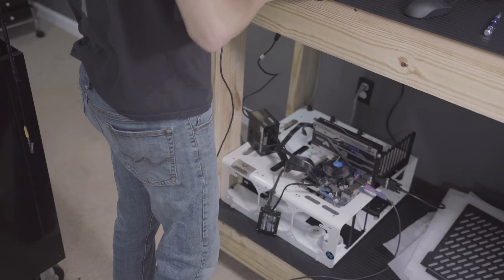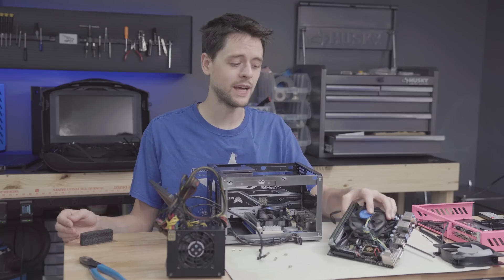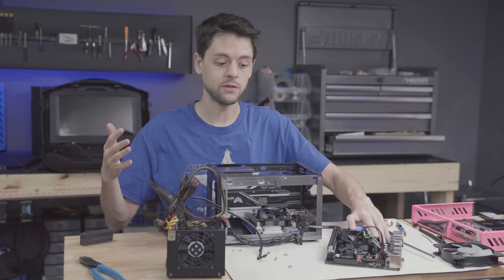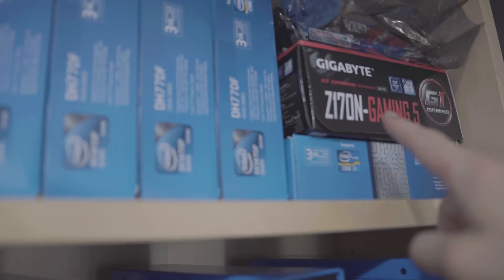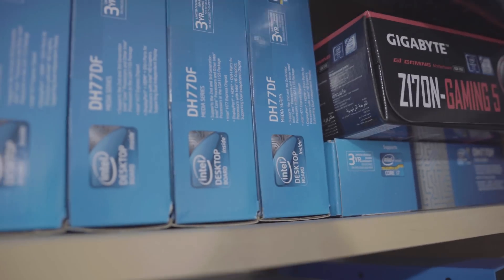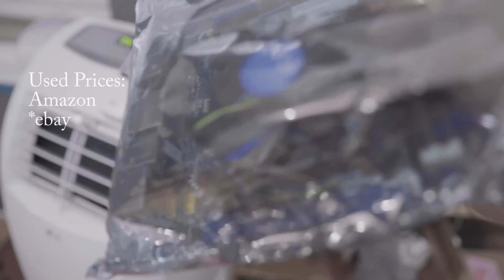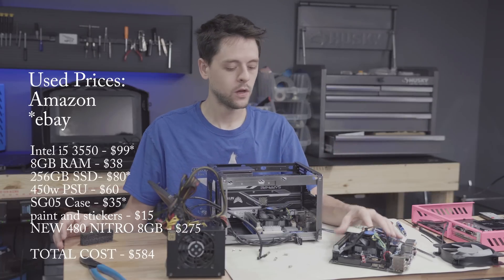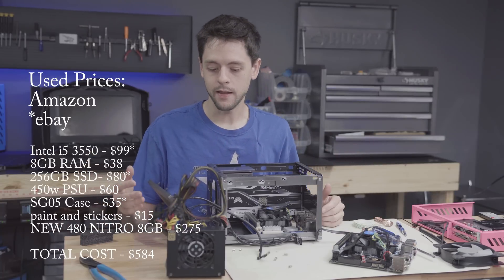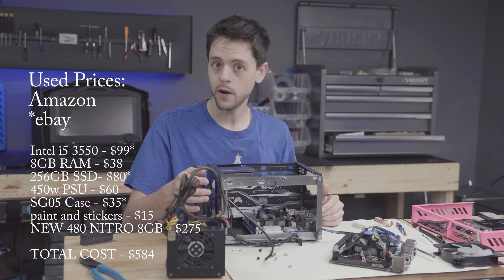I did put the system on the test bench and everything looked really good initially, so I installed Windows and started running applications — but it started having problems and would eventually hang on POST indefinitely. Since I want to move on and actually do some VR stuff, I've ripped out a super-stable Intel Ivy Bridge motherboard from one of my video streaming boxes. I know this one is working and tested, and it's going to get me back into the action as soon as possible.